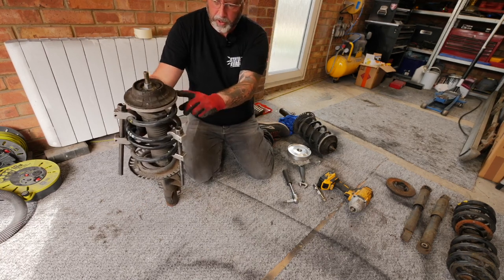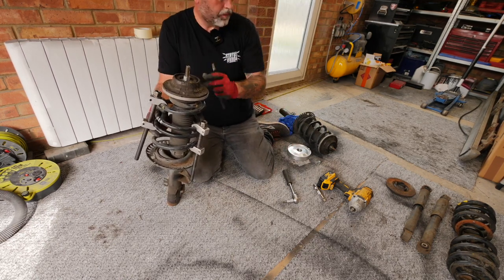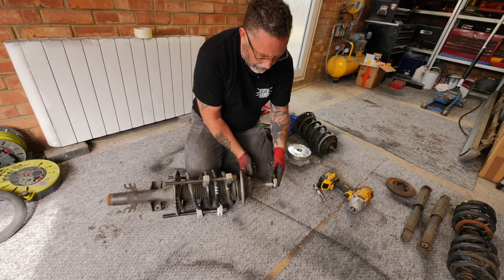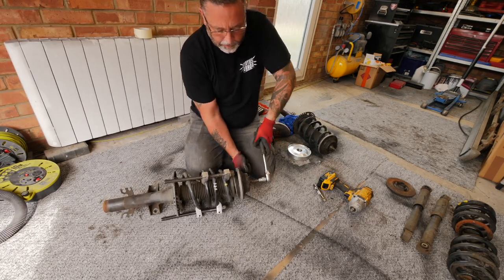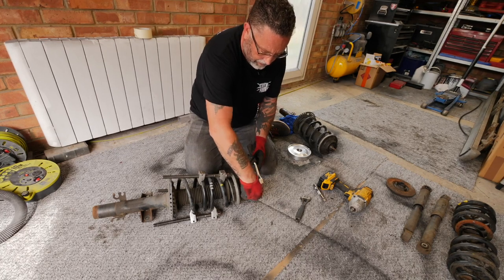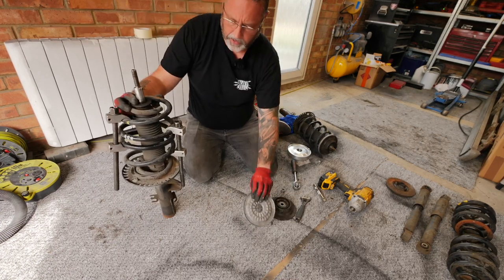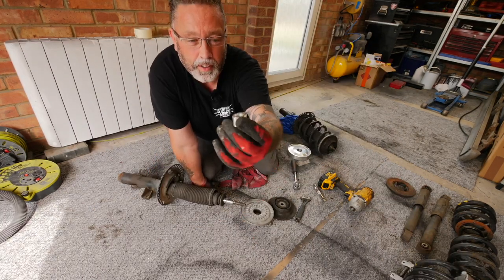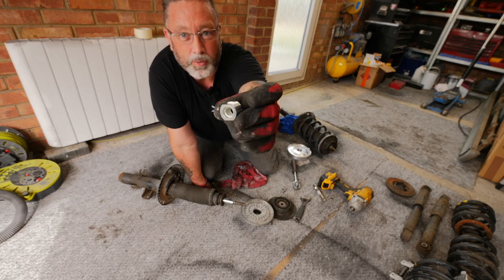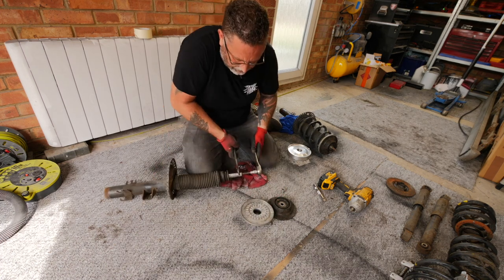Right, the weight's off the top cap. To get this top nut off — it's a 21mm nut, and I've got every spanner except a 21, so I'm using an adjustable which is not ideal. To stop the shock spinning, there's a 7mm Allen key to put in the end. Top nut off, take this top cone off, take the top plate off, get the spring out of the way. To fit the lift kit we first put this little spacer bolt on the shock — chamfered bit towards the top, flat bits towards the bottom.